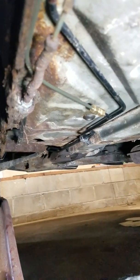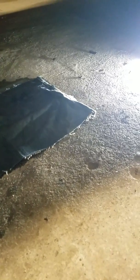I've got the brake line put in. I just wanted to let you guys know your pedal is still going to be very spongy until you bleed that line — or whichever line has air in it — because you just changed it. So you want to make sure you bleed your brakes right after, and then your brakes should be working perfect again.